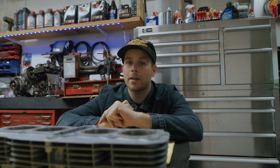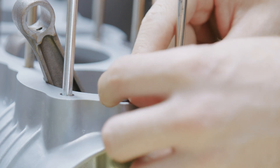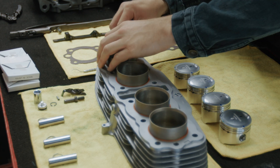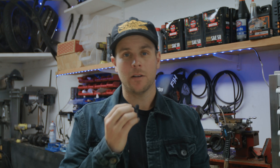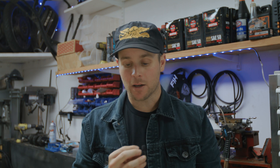Make sure you put those jets in the case — there's also an O-ring that goes around the bottom of each one to seal it off. On the cylinder there are special little orange O-rings that go on the base of the cylinder. It's important that you don't forget those either because they help with sealing.